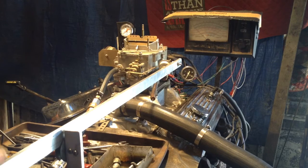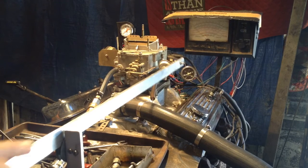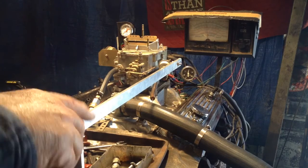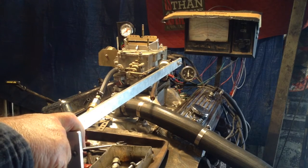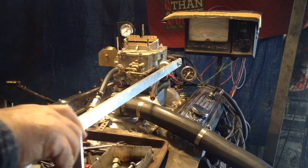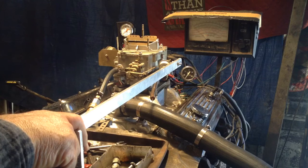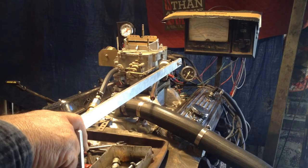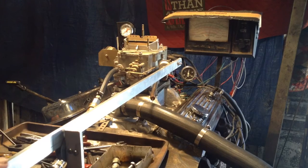We're going to see if it'll run. I see why you sent it in — it barely runs. Let's start putting some pressure on it. That's what I thought. The reason it's dying out is because the interior of the carburetor is not conformed for today's fuel.